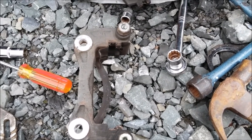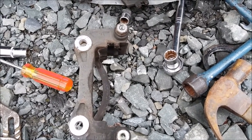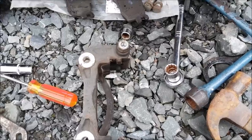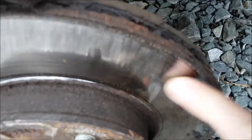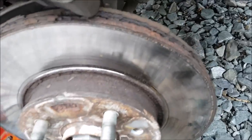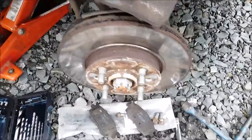I shall attempt to do it as an unqualified mechanic and I'll put it all back together. Hopefully the disc comes off okay — it is looking a bit crusty but it's still working fine, probably a millimeter off on each side by the looks of things. But it's time to replace it anyway; it's done 78,000 miles.